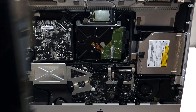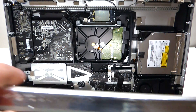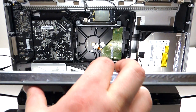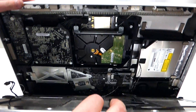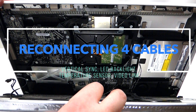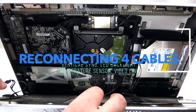To reinstall the LCD, go ahead and take the LCD unit and put it in at an angle like this, bottom first. Be careful as the iMac might turn — hold it very firmly and control its upward and downward movement.